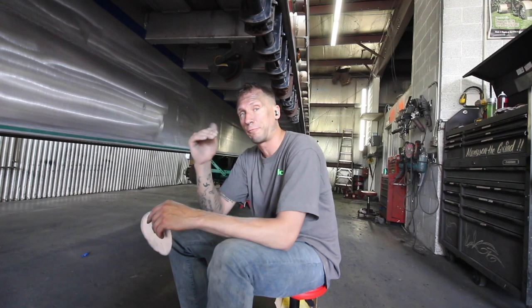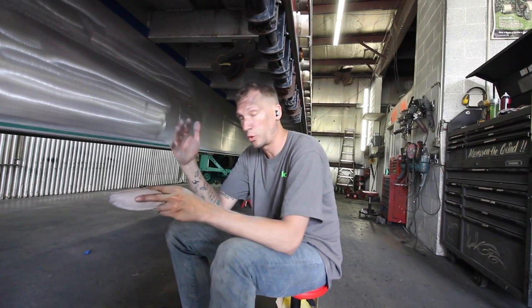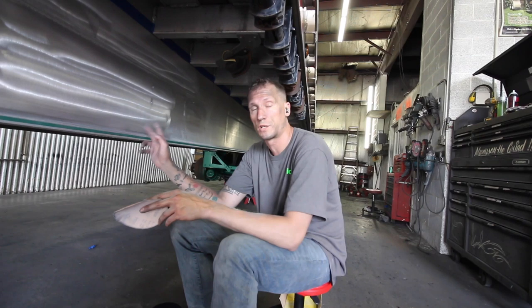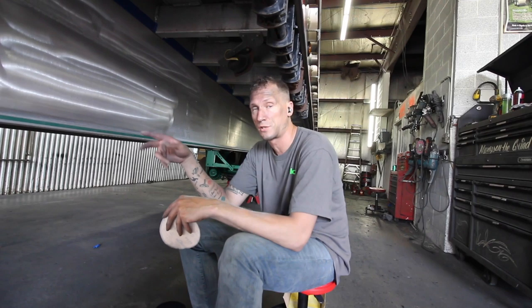Now why do I rotate between my rotary and my DA? If you watched our sanding video on aluminum, you already know why. Check that video out if you haven't already seen it. It'll explain all that. But if you don't know how to rotary and you haven't practiced on something smaller, this is the worst place to practice, because if you leave a half moon somewhere, you're going to see it in your finished polish.